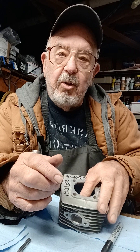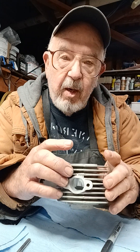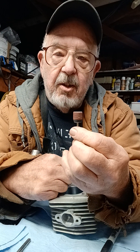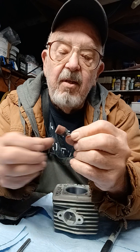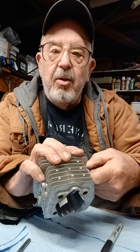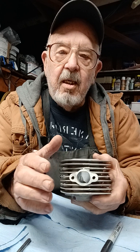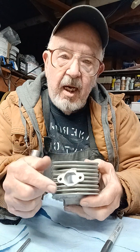I've got it cut to 178 where I want it. That's what I like — I've got everything just the way I want on that exhaust side. So then all I've got left to do is grab the very fine sandpaper wheel and put that in my porting tool, then run it in here to smooth it up really nice so I don't have to worry about any rough texture. Then I'm pretty much done with the exhaust.